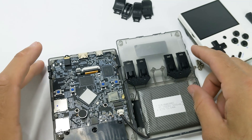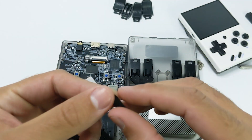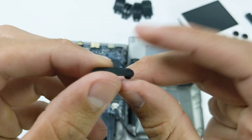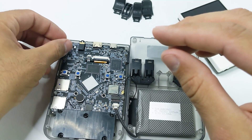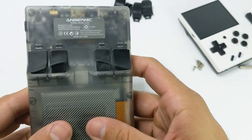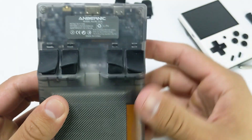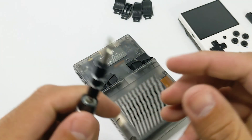Before I close that up again, I did mention that I put a little bit of tape on the hinges. I also added a layer of tape right here — it's just electrical tape. I did it here and on the volume buttons. That's just to make them sit a little bit more snug. It's only one layer — if you do more than that, you won't be able to press the buttons, but it just reduces the rattle a lot. Once those are on there, we're just going to clip it back on. See, there's almost no rattle now. And we're going to put the screws back on.